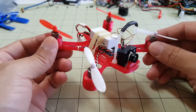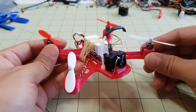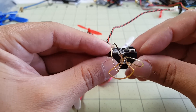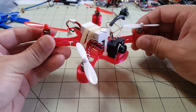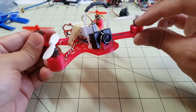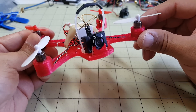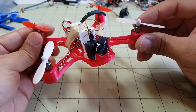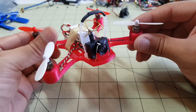For my next build I'm going to select a different, much lighter frame, and still combine it with the all-in-one camera VTX. Maybe get rid of the case to save about half a gram — every gram on these builds counts. I'm also thinking about getting the Spintech motors — 8.5x20 brushed motors, same as these but supposedly with even more performance than the Dark Edition.